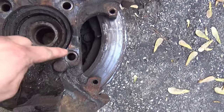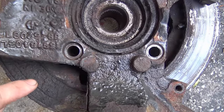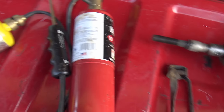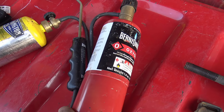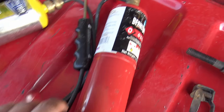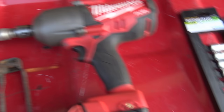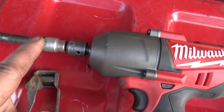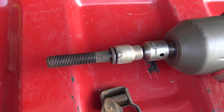One of the bolts is accessible, but the one way down in there requires the special bolts, especially for that recessed location. What we ended up doing was using MAP gas with an oxygen mixer — kind of like an oxy-acetylene setup where the oxygen burns it hotter — with a very fine tip to get in there. Once we did that and used the extractor, even a cheap set gripped them and they came right out. You're most likely going to run into this unless you live in the lower states where they don't use salt on the roads.